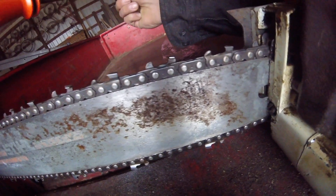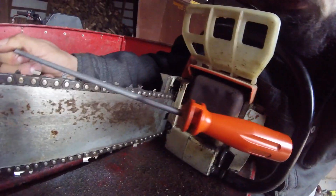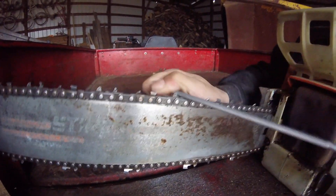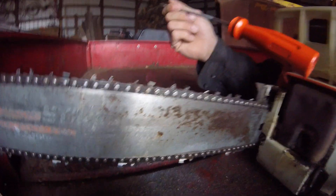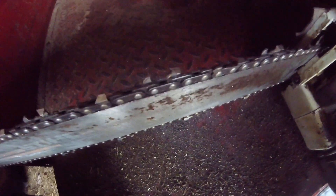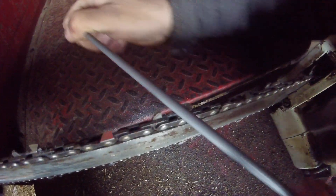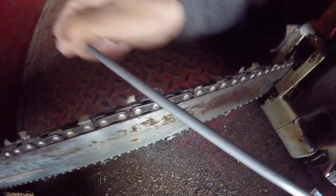The gullet's gone — that one still has one yet. Now we'll work on the top plate at a slightly downward angle. You keep working it back until it's straight all the way across. Even though the tooth is boogered, you'll be able to work it back until it's straight across. You might have to work it back quite a ways. Then you'll have to get your gullet back out again by putting downward pressure on your file, so you keep that going — always open.